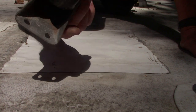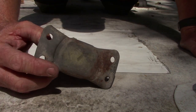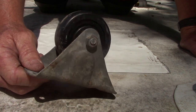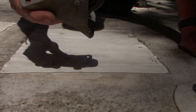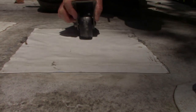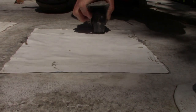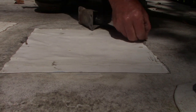And yes, they make special rollers for that. So years ago when I bought my first Eternabond, they didn't make the rollers yet. So I just went to Lowe's, picked up that little handy dandy roller for a couple bucks, and it works awesome. Just really want to roll this out really good, because like I say, it activates with pressure.